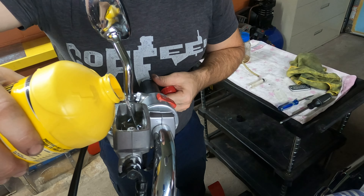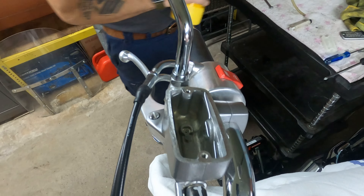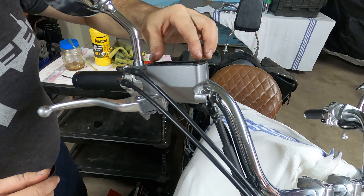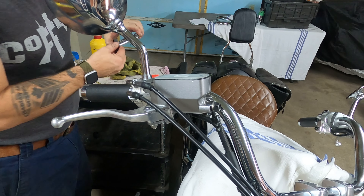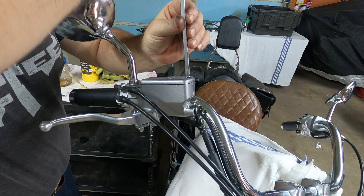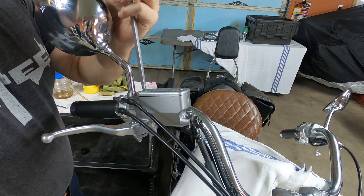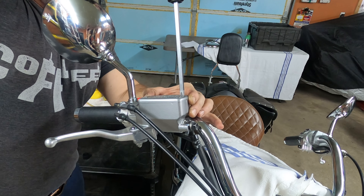What I'm going to do right now is close it and have a quick look. You want to run through the entire container up here, or until you see the clear fluid. We already ran through the container up here, so I'm fairly satisfied with this. I'm going to close it — it's closed — now remove the hose, put it away, and wipe it as best as I possibly can. Now we're going to top up the reservoir right here.